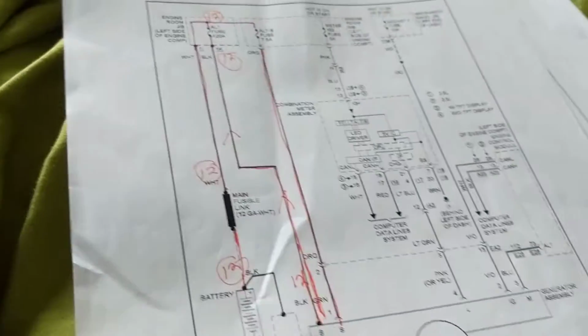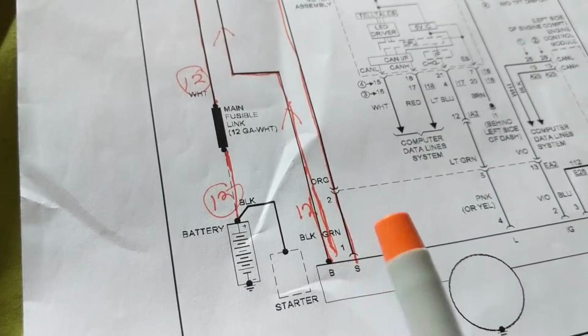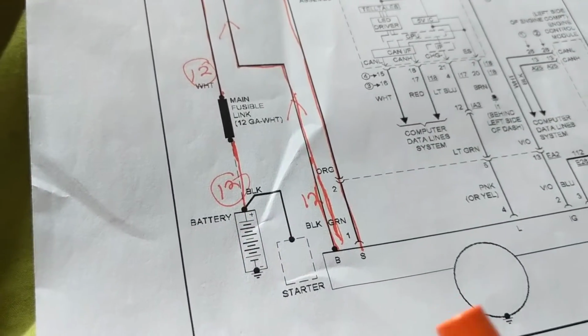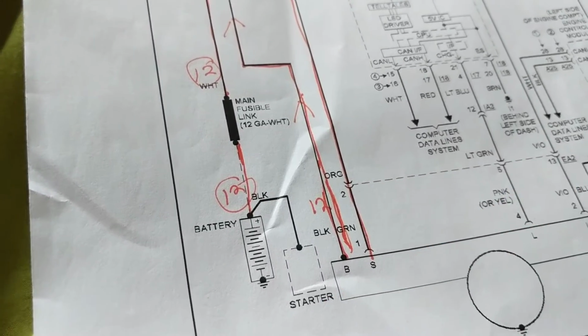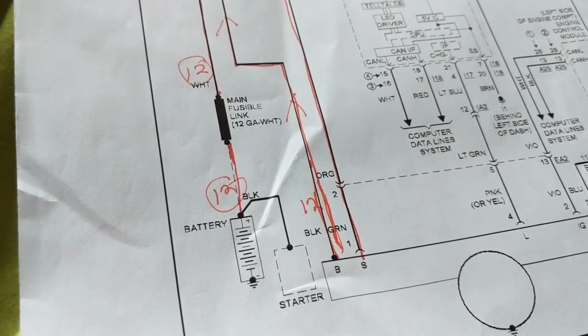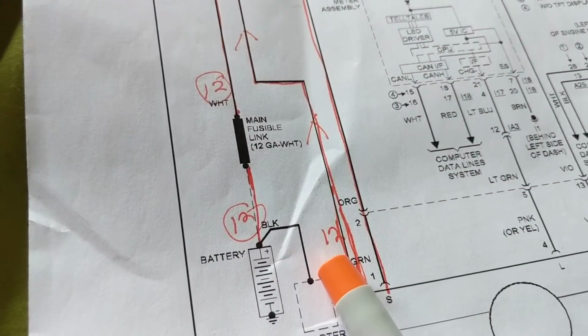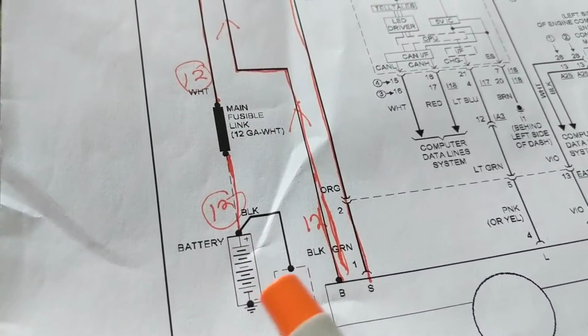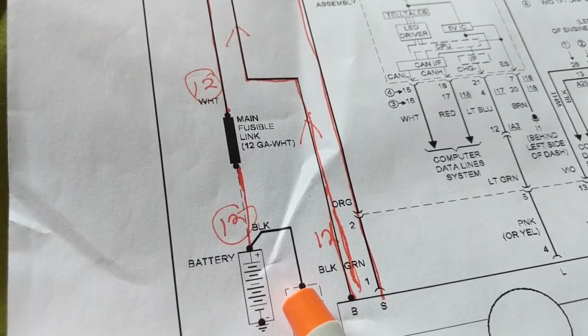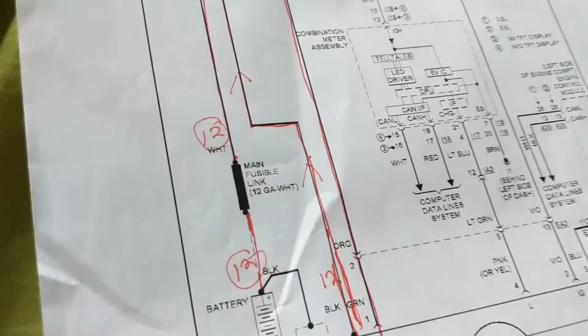So what can I do? I think that maybe the alternator failed. It didn't do its job, and it didn't replenish the battery, and it's not the fault of the battery. What can I do? I can recharge the battery, right? Well, again, I'll go and do it. Boom. It starts, and then nothing happens, right? Why? Did the alternator fail again? Is the serpentine belt turning?